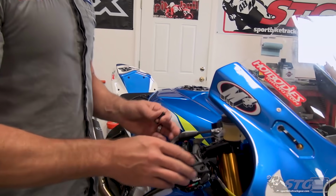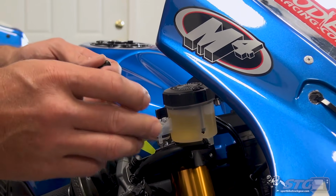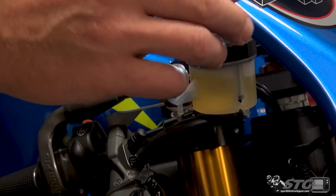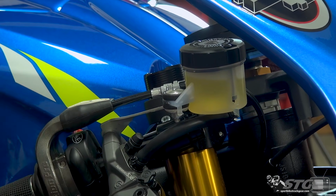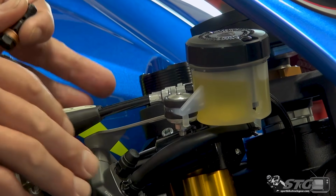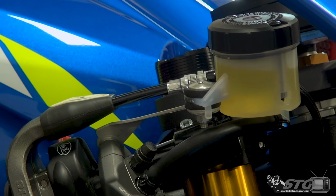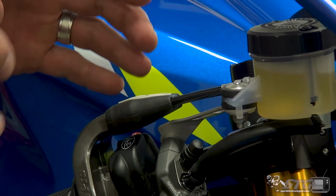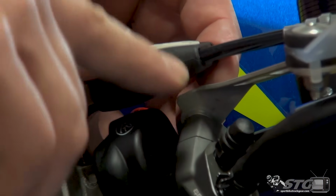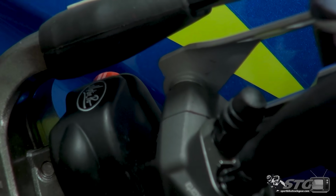The master cylinder itself can be installed by using the optional reservoir kit, which I highly recommend. That's what I put on my bike, and that should be a great sign for you. It is designed to work with the Brembo racing master cylinders. I really think this is a must-have if you're going to install the RCS Corsa Corta, the RCS 19, or really any of the Brembo racing masters. This reservoir makes it so much easier because it mounts right to the upper clamp bolt of the master cylinder. It is not included, it is sold separate.